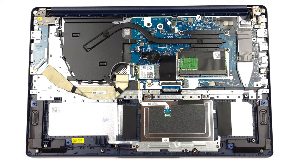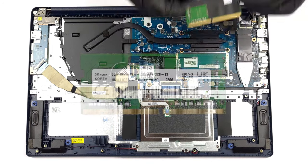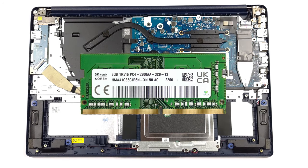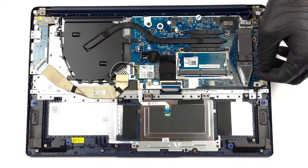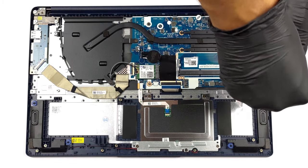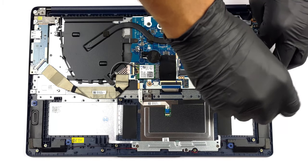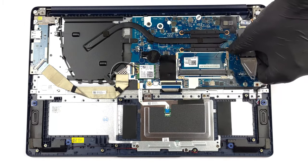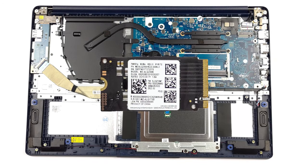The IdeaPad 1 comes with one SODIMM slot for DDR4 memory. Some units also come with additional 4 GB of soldered RAM of the same type. For storage, there's a single M.2 PCIe x4 slot for Generation 3 SSDs. To take apart the laptop, we'll refer you to our teardown video, which shows a step-by-step process. You can check it out in the description.